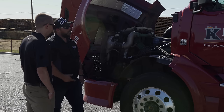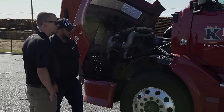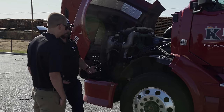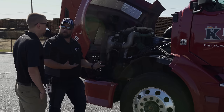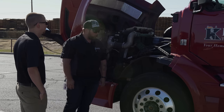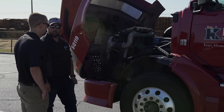If the pressure is below 100, we have air hoses on the trucks. I hook into my glad hands and it depends on how low it is — it can take up to about 15 minutes if it's real low, or a few to five minutes if it's just a little low. I won't roll without my tires at 100.